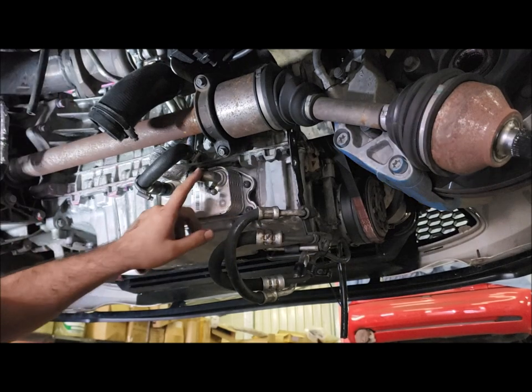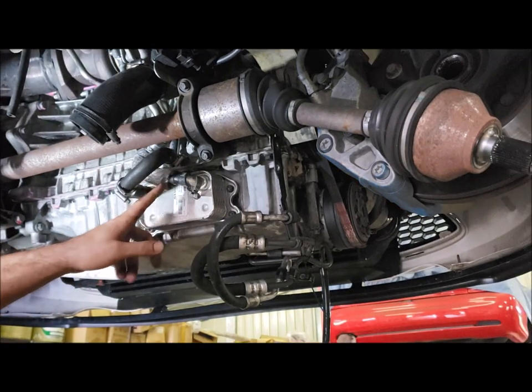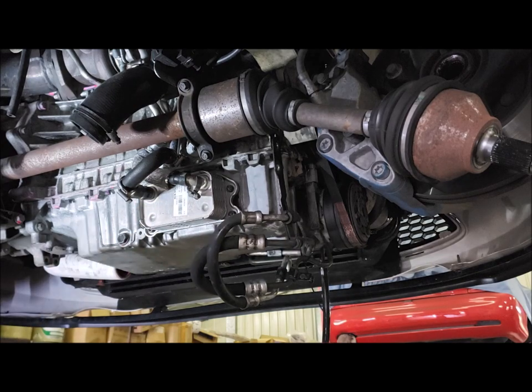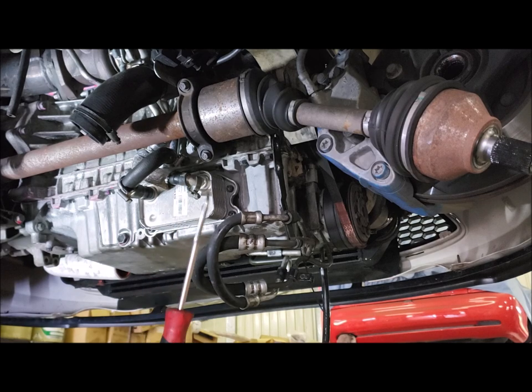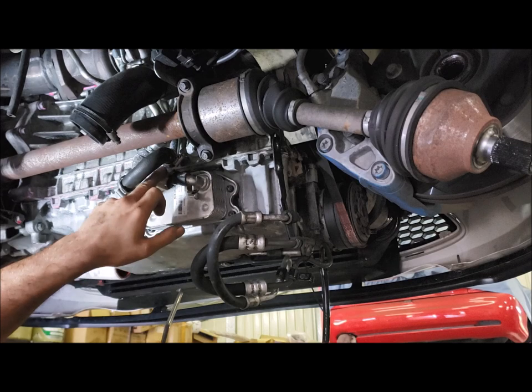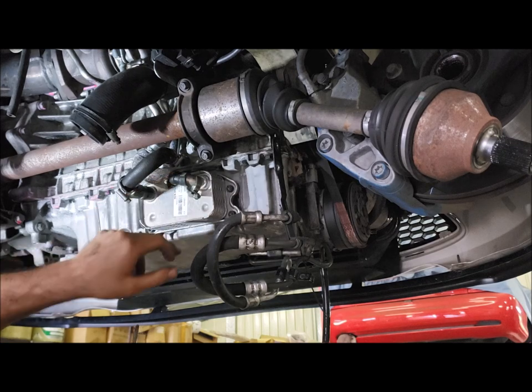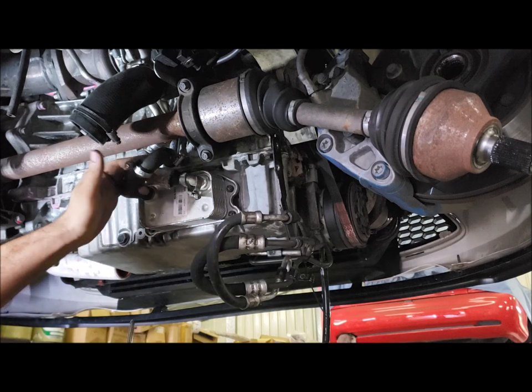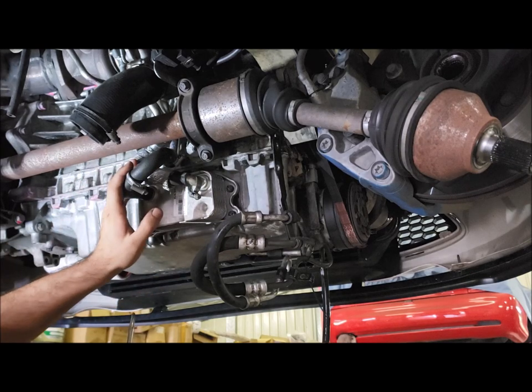I always like to do this hose first, because if we release the other one, it's going to drain all the coolant and spray it everywhere — whereas this one just sits quite happily. You want to take a hose pick. It looks like a normal pick but it's blunt. You want it to be blunt because you do not want to punch a hole through one of these hoses. If they're leaking, swollen, weeping, or showing any signs of coolant leaks from pink stains, replace them.